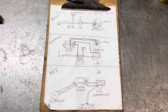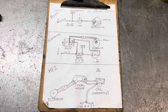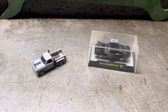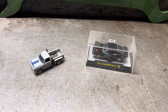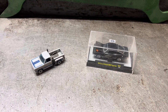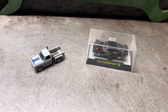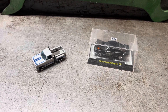In the case of any of these systems, you should definitely seek out a detailed and color coded wiring diagram. I am a firm believer that the factory pieces are just fine for most applications. If you're not trying to run in the sevens and do humongous wheelies, points or an electronic system like I've described will work just fine. You really don't need to run out and spend 500, 600, 700 or however many hundreds on an MSD system for a street driven car.